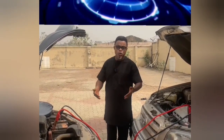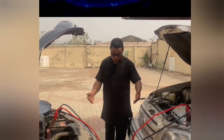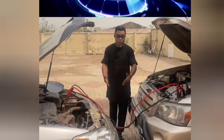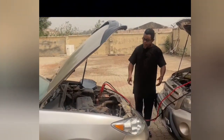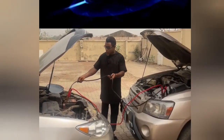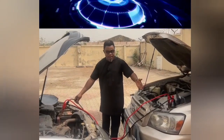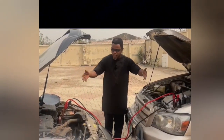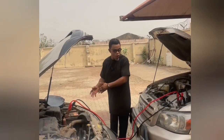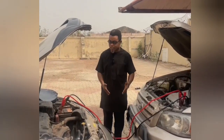There are some dos and don'ts I need to call your attention to. Number one: ensure you bring your car close. As you can see, we brought them bumper to bumper, nose to nose. Depending on the length of your cable, if you have a longer one, you can park side by side — as long as the cable reaches from the donor battery to the receiver battery.